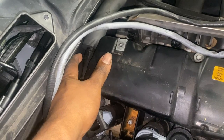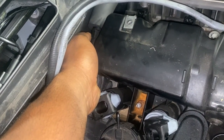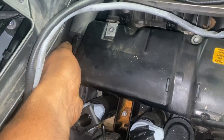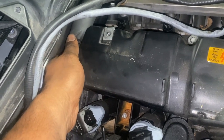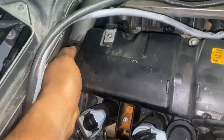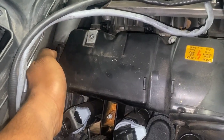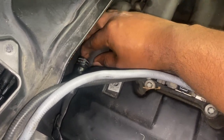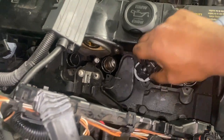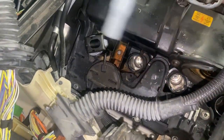This PCV vent piece is more than likely going to break. You can try not to break it by pushing down and pulling it back towards the right. You may need a small flathead to help pry while pushing — you really want to push down and get it off. If you break it you have to replace the whole thing. Since I already have a new one in this valve cover job, I'm not too worried, so I just popped it right off. I then popped the coil packs back out since there are no more bolts that would drop in now.